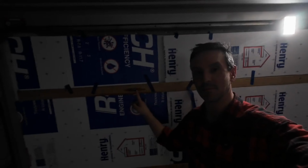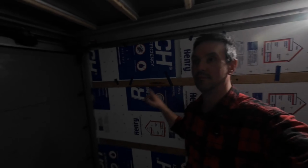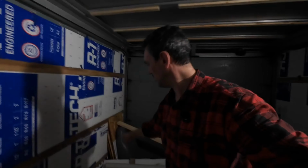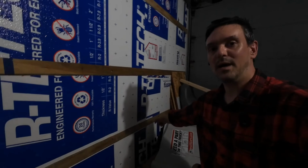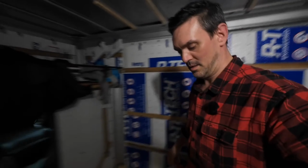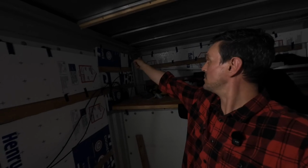There've also been 3 major leaks that I found. The first one is here at the back, which is pretty visible when you look at it. That screw does not have sealant on it. There's another one over here. This screw as well is wet, and the one that I noticed when I first came in is where I scraped the roof.